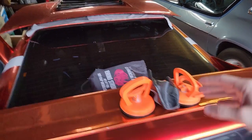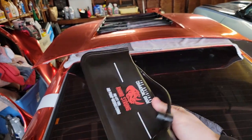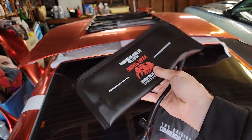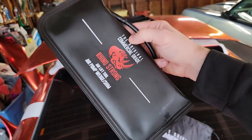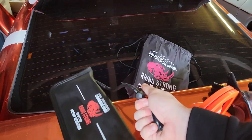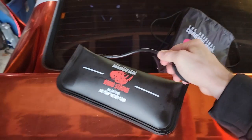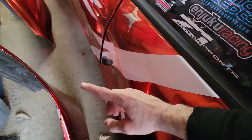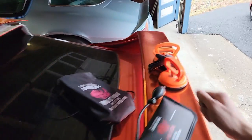I'm also going to try to work on the dent today. I bought a vacuum pump kit - I checked auto body stores online and they had single ones for around $50, but this Amazon kit was $25 and comes with three pads, with the largest one bigger than what I would've gotten elsewhere. Basically, you pump it up like a blood pressure cuff, the pad expands, and the idea is it pushes the dent out. I have three, so I can work all of them together to build pressure.